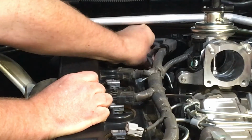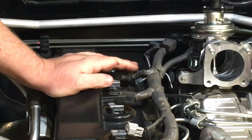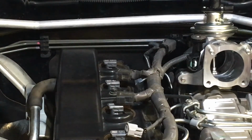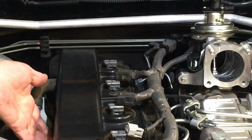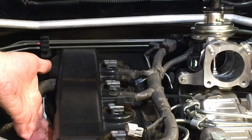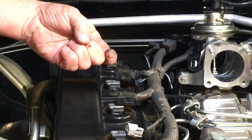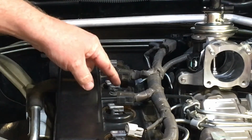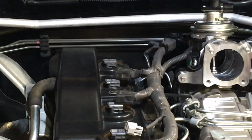I might as well tell you how to get that off. I'm sure you can figure it out yourself, but I'll tell you anyway. Right, so you get these out, whichever ones. It's best if there's only one like that. So you try and undo it, it's spinning, nothing's happening. Well, you need to have a heap of pressure on it, right? So you need to pull up on the cover here to have that pressure against it. Put your impact driver, just spin it anti-clockwise. Look, blood. You drew first blood. Anyway, keep it spinning and keep the pressure up, and the whole stud will come out. And then obviously put the stud in the vise, get the bolt out, clean, glue the stud back in where it's meant to be. Key thing is though, is to not over tighten.